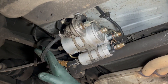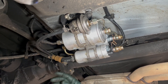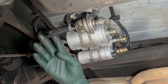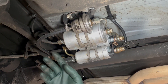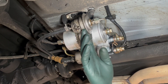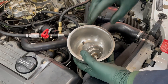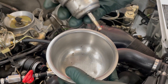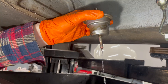You just take this hose off and see if it's leaking, but you have to be really careful, particularly on the 300E. Notice this hose is running horizontally, so you have fuel coming out of the tank and fuel is already filling this hose. If you cut the hose and see fuel and assume the accumulator is bad, you can be fooled. You want to make sure the fluid is leaking out of the accumulator — it should not be leaking out of this side. There's a diaphragm in here, and once that ruptures, the fuel can just leak right back down. Here's the old accumulator — when we removed it, it was absolutely full of fuel. We just tipped it up and it kept draining and draining.